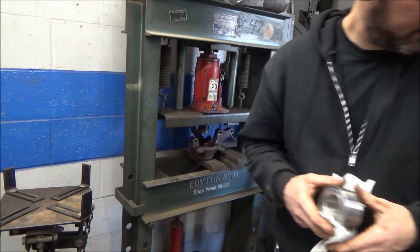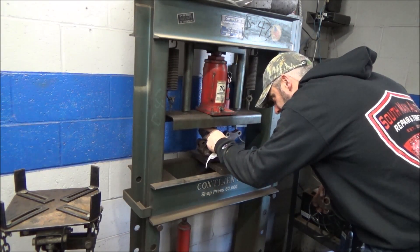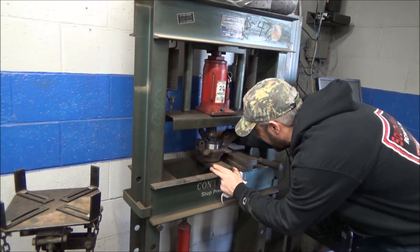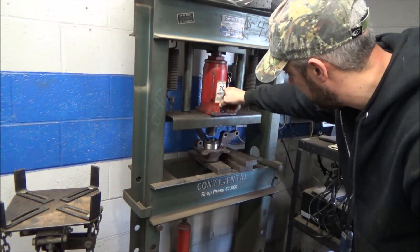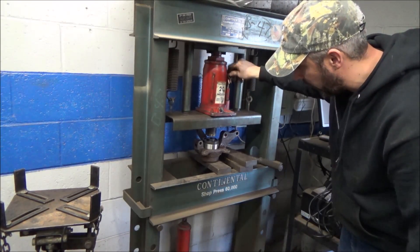The other thing I've seen that you have to be mindful of is a stepped outer race, where there'll be like four or five thousandths difference from the inner to the outer. Believe it or not — usually that's pretty clearly defined with a line right down the middle. You can hold it up on edge and look at it or measure it. I think you see that on some Euro cars. Stepped outer bearings or stepped outer races kind of prevents you from putting it in backwards. We'll get that set up on there — got a little block. We'll see if we can't get it started straight. That's half the battle.